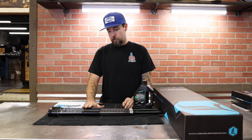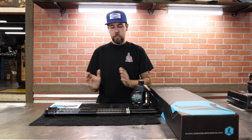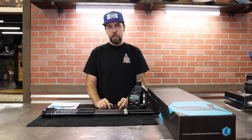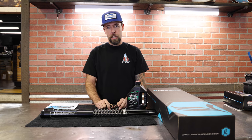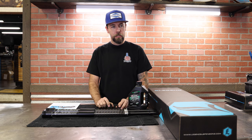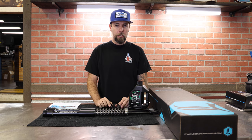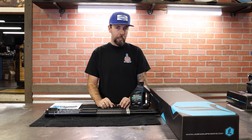What you're doing here with the monotube kit is inserting a nitrogen-filled cartridge that controls all of the dampening and rebound. You're better able to set that up and get better control and better feedback from your forks, gaining stability, traction, and high-speed cornering a whole lot better when you have a setup like this. The oil we put back in these forks with this kit is really taken out of the equation of dampening and rebound — it's just there to keep everything lubricated and moving up and down correctly, not controlling any of the rebound or compression action.